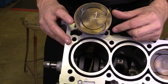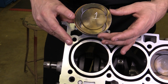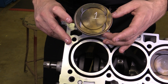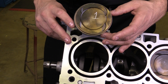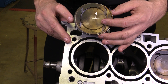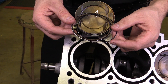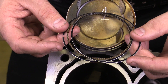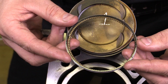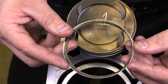Just the names of the piston rings: this top one is typically called the top compression ring. It helps to seal the compression gases as we have combustion events right here at the top of the piston. I may have a second ring below that — an additional compression ring also for sealing purposes of the top into the combustion chamber. And then at the bottom, I've already removed the ring. I've got an oil scraper and this little wavy washer. The main purpose of this is: as I get oil on the cylinder wall for lubrication purposes, I want to be able to scrape that down and keep large quantities of oil from getting up in the combustion chamber and being consumed.